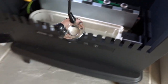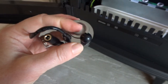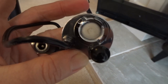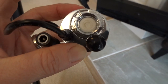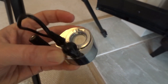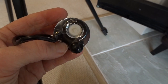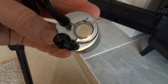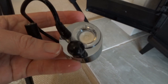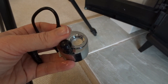This is often the reason why your fire isn't working. It's really important to give this a really good clean, particularly around here. Can you see there's a little bit of discoloration on the white area? Those are deposits so they need to be cleaned off. I use a toothbrush and some washing up liquid and go through and give that a really good clean, then dry it — all of those deposits will go. Even though I use filtered water in my tank, there are still water deposits on my transducer.